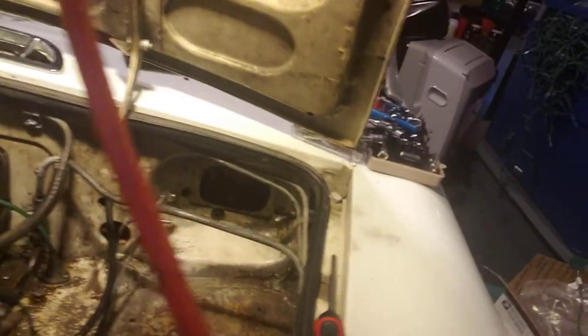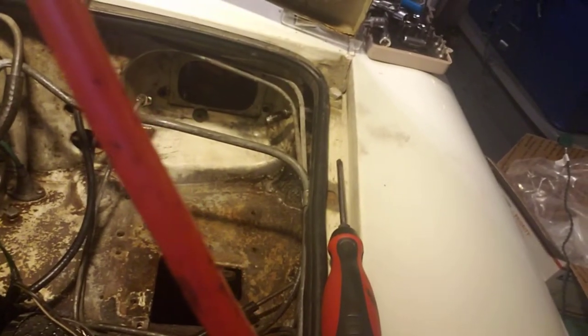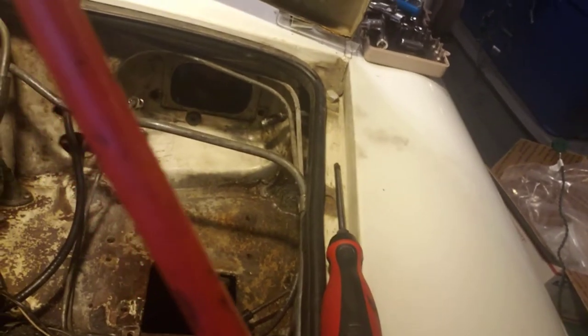I've got it all removed — it was a pain, thanks to this fuel line, but it's out. We're cleaning up; I just poured some degreaser in there with a bucket underneath to catch everything from hitting the floor pan because we had some brake fluid leakage. We're going to clean this up better with a wire brush, then coat it with some POR for rust prevention, just like we did everywhere else on the car.